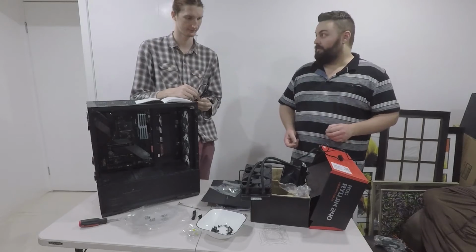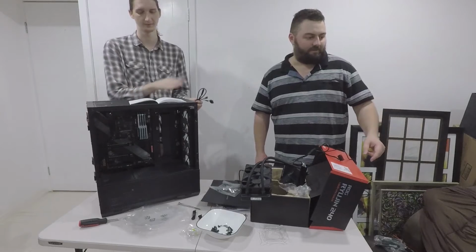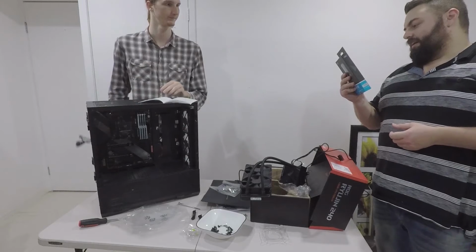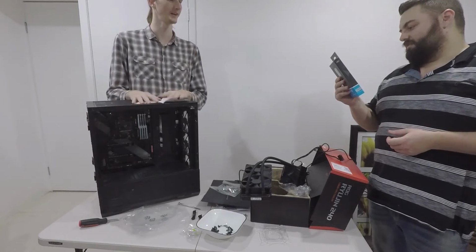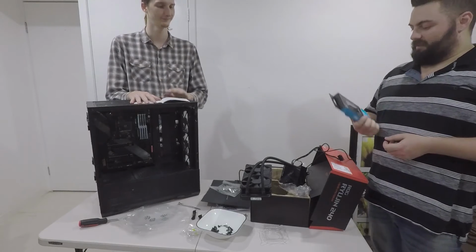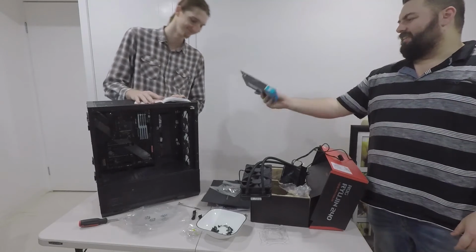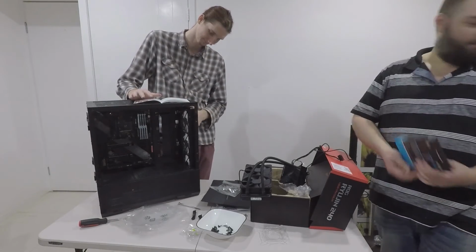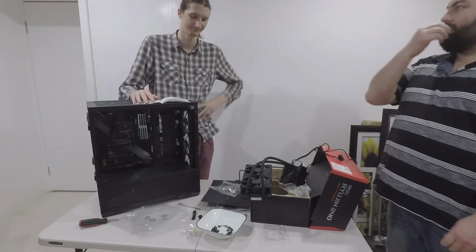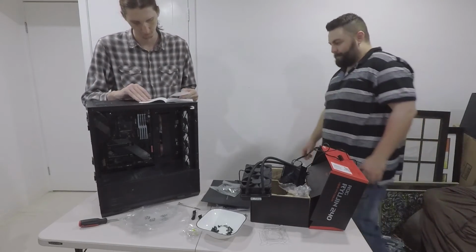I've got a fan hub. That's right. Yep, you're going to control it through that. Yeah. I got a Cooler Master one. All right. So we can probably disregard this. Yeah, because I can fit 10 fans on it. Oh yeah. For PWM, which is the variable things. But this one's a no RGB one, so I bought it because I'm not a fan of RGB other than those 3, and they've got their own header to plug into. They'll just get plugged directly into the motherboard ARGB header. Cool. So I think we could do that now.